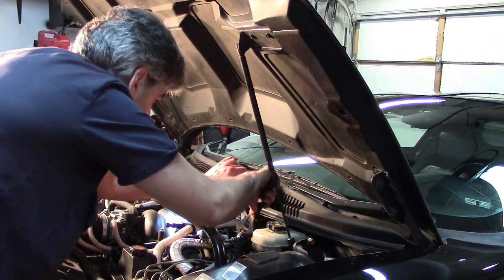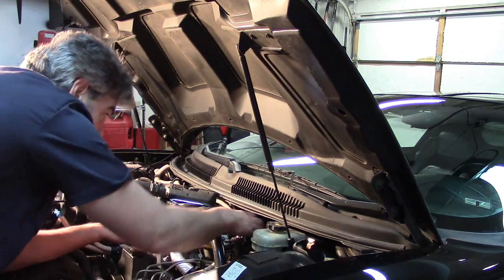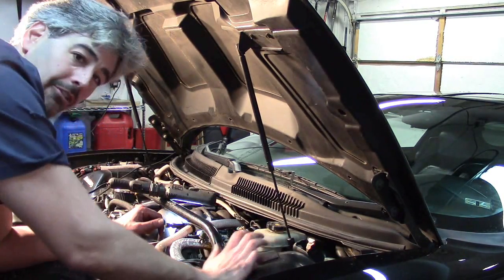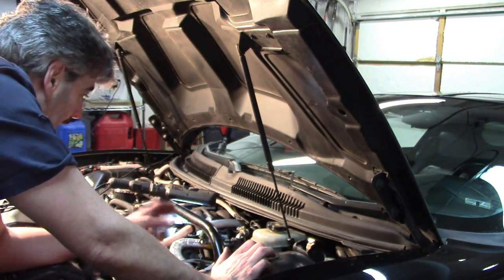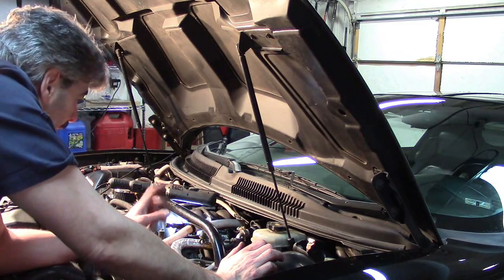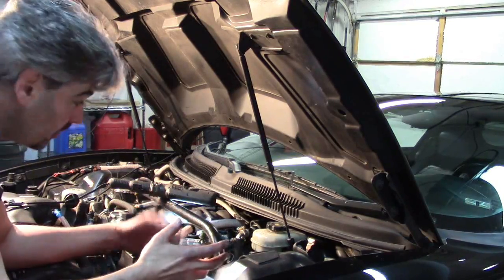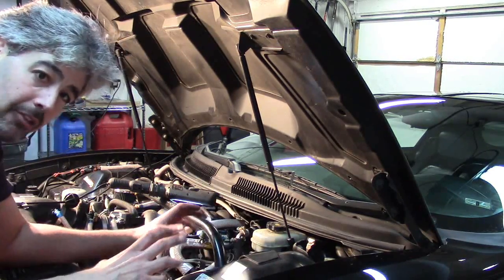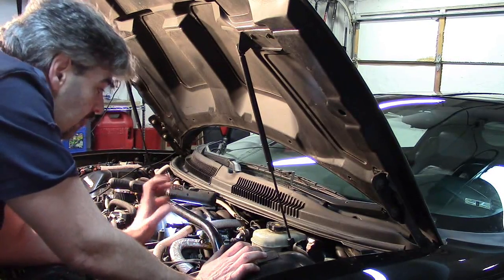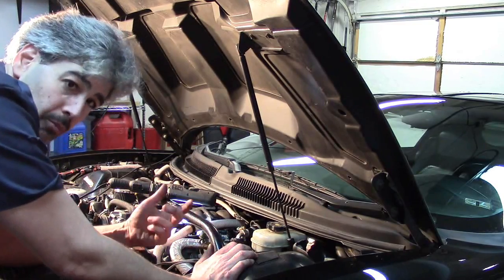Oxygen sensor codes are fairly notorious for this. If you think about this system, you have the potential for referenced codes. If I were to leave a hose open like this to the exhaust manifold, air could come in causing a lean condition on that bank. In this case it's bank 2, so it would be a P0174. The actual cause of the lean condition would have been from the air pump system. So it's important to remember how this system interacts with the rest of the engine so that when you have a symptom like that, you can think of every system that could be contributing to that check engine light code.